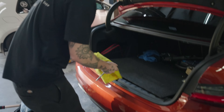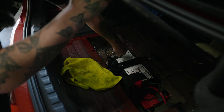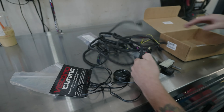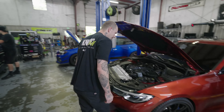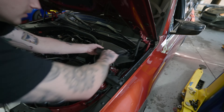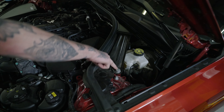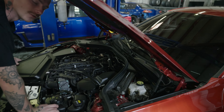Step one, we're gonna disconnect the old battery tray. Take the wipers off and then take these plastic covers off. There's a couple — I believe 16 and 18 mil bolts you have to remove.